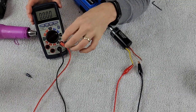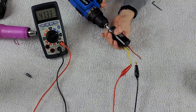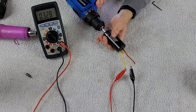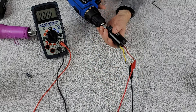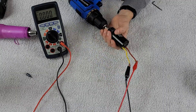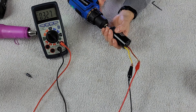First I'm going to throw it over to our frequency measurement and spin up the drill. We now have our frequency for that phase and we're going to use that frequency for every measurement we do. I'm going to switch over to AC voltage and test our first phase — 0.329. We're going to switch the lead and measure our second phase — 0.329 as well. Now we're going to swap to the last phase — right around 0.327 to 0.329.